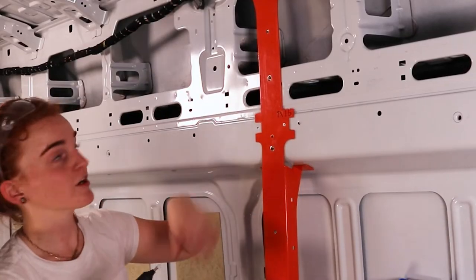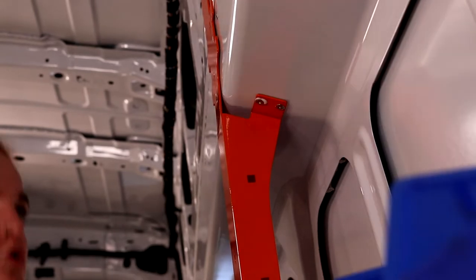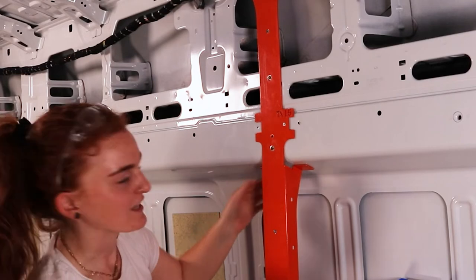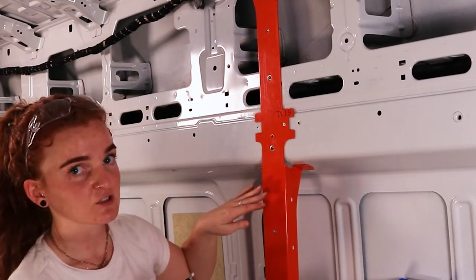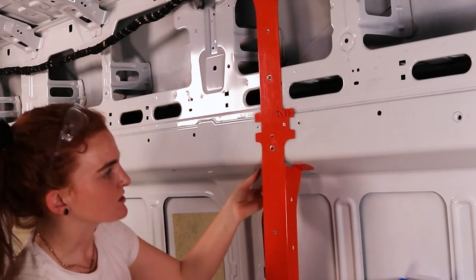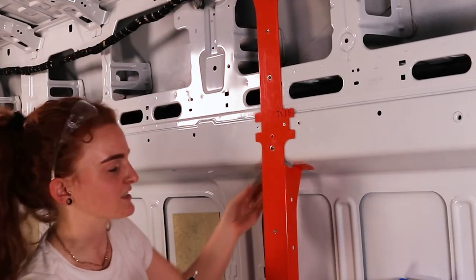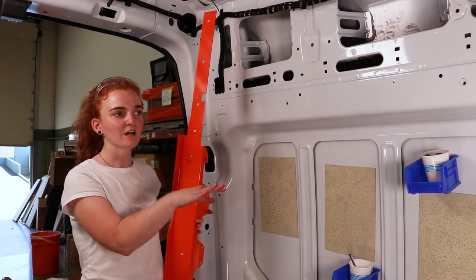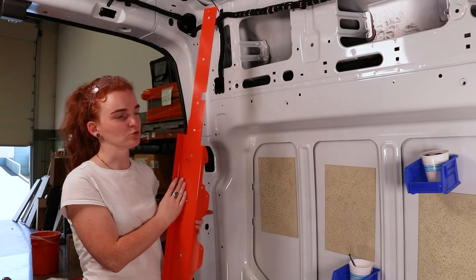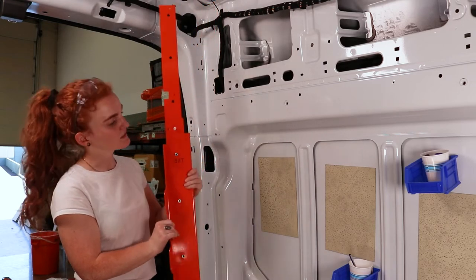All the other pop rivets are set, so I'm going to do this top piece now. We actually ended up not having to mallet it at all — but like I said, totally fine if you have to, just leave that to last when you have everything nice and secure. Ours ended up pulling itself closer in as we made the other attachments, and it's nice and flush now. After we have vertical support 1.5 set, we can move on to 1.2, which is going to be right against your D-pillar by your back doors.